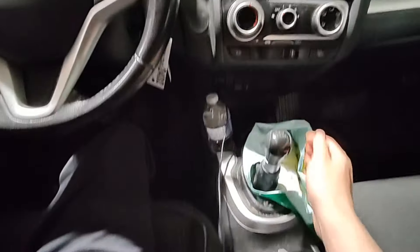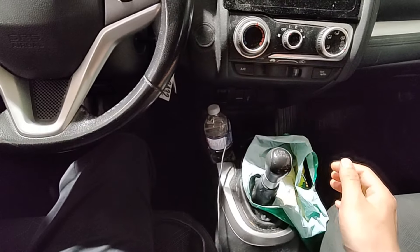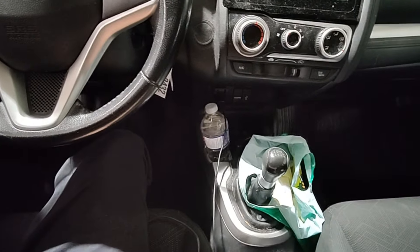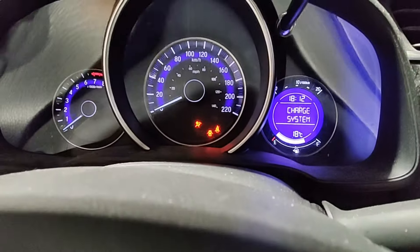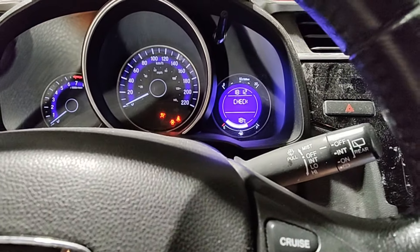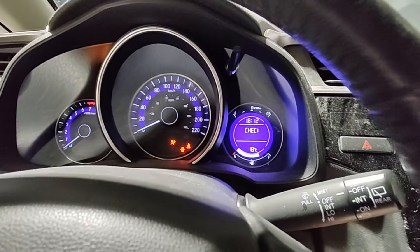So that is the issue. I got it in by rolling it down, stuck it in gear, and then the car started up. Also checked the charging system and it is not charging - that's also an issue. You've got a warning light on the dash saying 'check charging system' and there's no battery light. And also turning the key, I don't even hear the starter clicking, so that's also an issue.